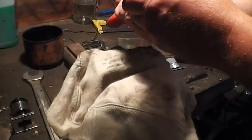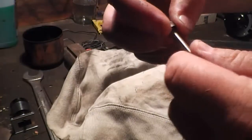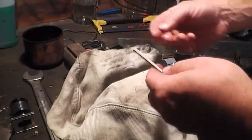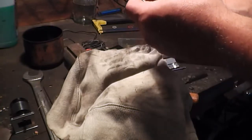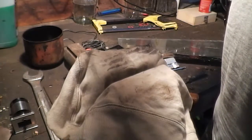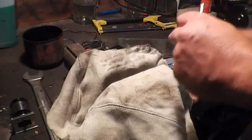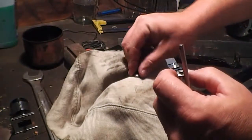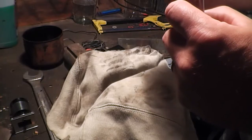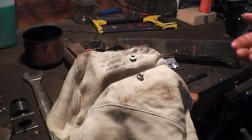I'm just going to see what this bearing feels like. I don't know if you can hear that — I'd say it's highly likely that's where my vibration is coming from. So that's going to get replaced and that'll be the end of that drama. I do have the bearings here. There's a big bearing and a small bearing basically. The big one is a 6867. I'll get the bearing numbers off properly in a minute.